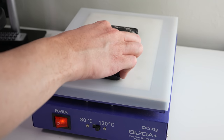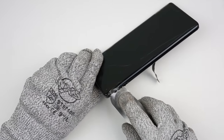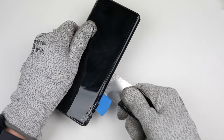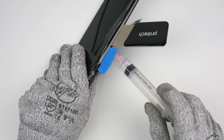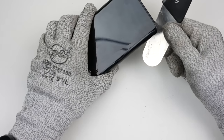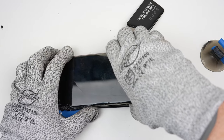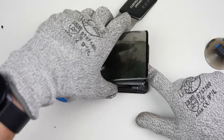And that's no easy task. As I'll be replacing the display alone without it being attached to a new frame, I'll have to pry the old one off. After the phone's been heated for a third time, I can begin separating the display. Motorola has used no adhesive around the left or right edges, but rather about 5mm in where the display sits flat. This means you'll have to get your prying tools around the 90 degree curve to even reach the adhesive. Using some alcohol helps aid this process, though given the strong adhesive under the mid section of the display, it will likely separate when you try and lift it out, similar to some of the Google Pixel models.